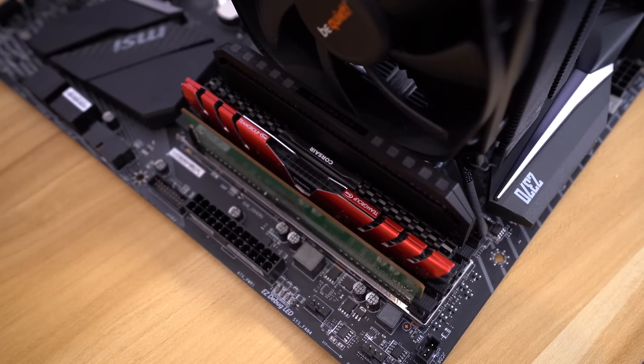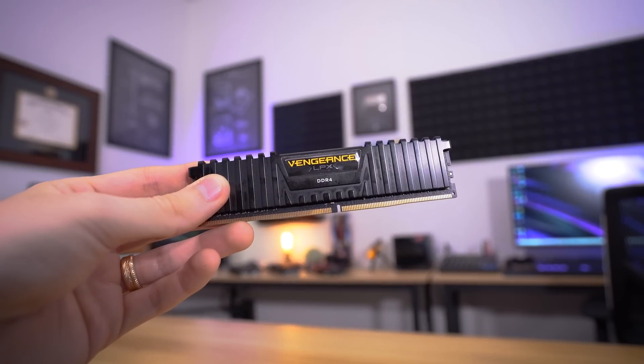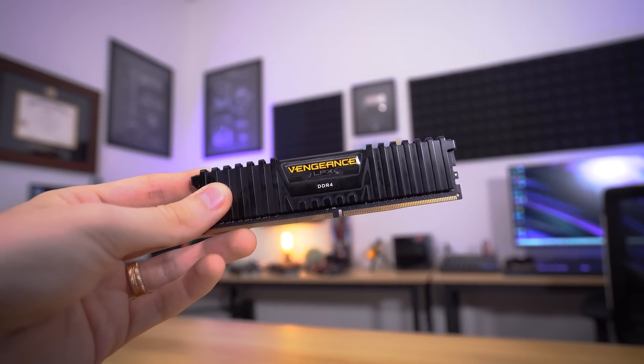In one of my recent laptop videos, I ended up opting for 20 GB of DDR4 in total with mixed modules and mixed speeds. 20 GB is a super weird number for DDR4 — typically it's in increments like 2, 4, 8, 16, 32, 64. I have 20 in my Dell because I'm running a 16 GB module with a 4 GB module. The 4 GB module is obviously smaller in capacity, it's also slower and the timings are higher, so it's really dragging down the 16 GB module — it's a Team Group module. I was hoping to run a matched pair for 32 GB total, but I'm willing to mix modules to have a higher RAM capacity overall, which is great for video editing and way better than the 8 GB the laptop came with stock.